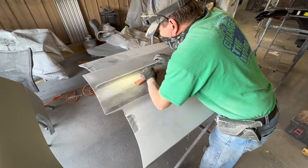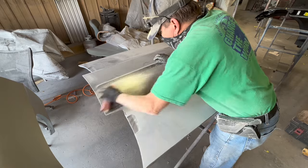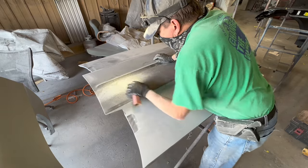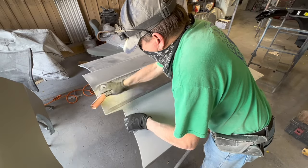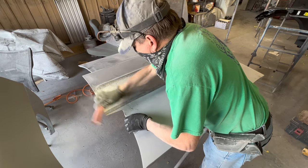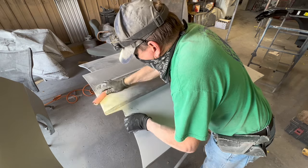It wasn't damage, but it went too far and cut out above the reverse curve, and I had to fix that. And we have the same issue here where the round block came out of the reverse curve to the flat part of the top of the hood scoop and undercut it. So I got to flatten that back out.